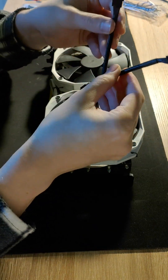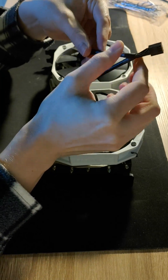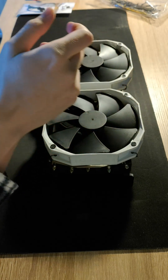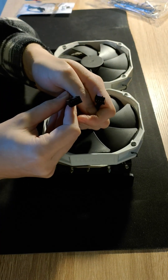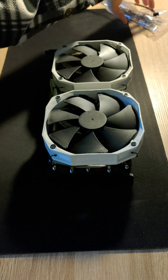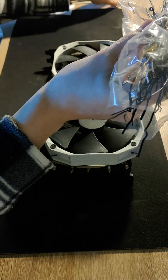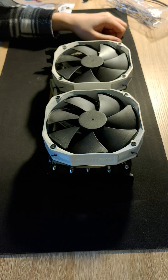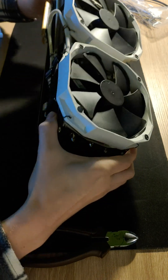To begin the job you will need a Vega 4-pin PWM fan adapter, which lets you connect standard case fans to the GPU fan header. I got three of those. Next you will need a PWM fan splitter that will let you connect two fans under one GPU fan header. If your GPU has two fan headers, you can connect two fans separately with PWM extender cables. Some wire will also be needed to mount the fans. Zip ties might seem good but not for the way we are going to use them.